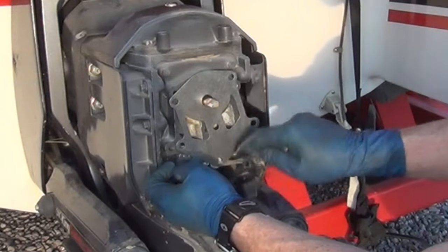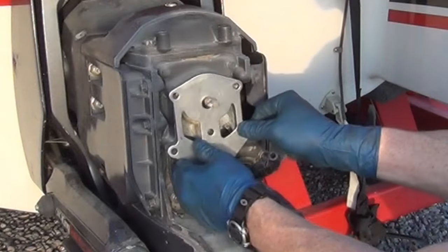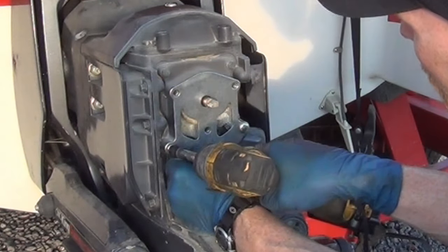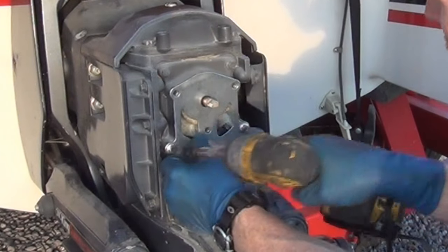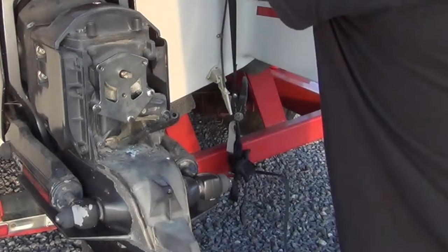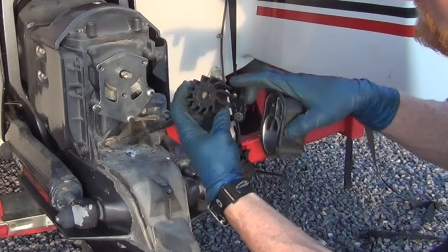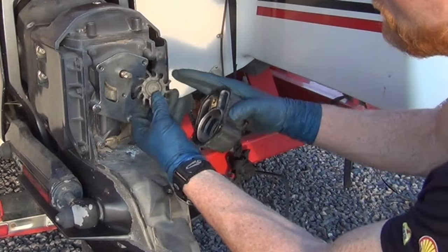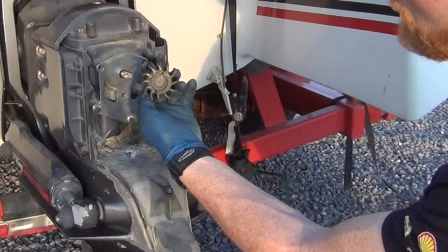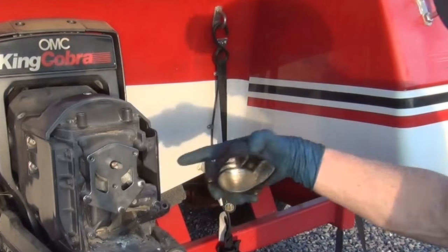You can't put this on wrong because one of the bolts is offset — it's not at the very bottom. It looks like some kind of superhero mask. If you tighten the bolts just partially, it's a lot easier to get your other bolts in. If this is a little bit crooked, it can make it difficult to start your other bolts. When we took the old one off, it's a good idea to check and see which way it's smushed or rotating. You can tell this one is worn on one side and goes on this way. So when we put the housing on, we want to rotate it the same direction that the memory is on it — in this case that's counterclockwise. If you look closely, you can see there's an arrow on the end to indicate where the point goes. This is a triangular shaped thing, so you want it pointing the correct way.